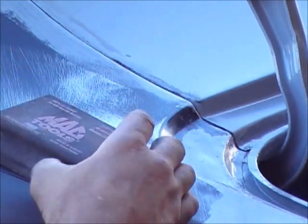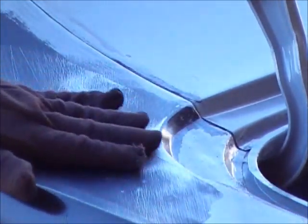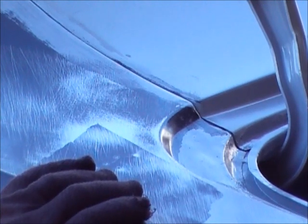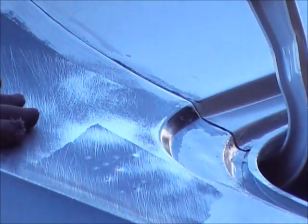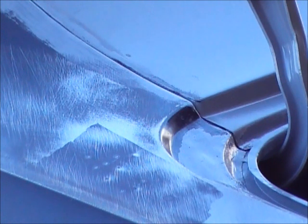It really does feel pretty good - I'm really happy with what I've got pulling in there. I'll sand this all down, run my sharpie back over it for my guide coat, and then block it out using a regular flat block going with the transition. I'm trying to get all those dents really close - within thirty-seconds, sixteenth - where there's almost no filler at all. I'm actually a fan of filler, I think it's fantastic. I had probably a quarter to a half inch of filler in my car and it lasted 20 years before it started cracking. Filler gets a really bad name, but for me this metal work is where you get your skills honed.